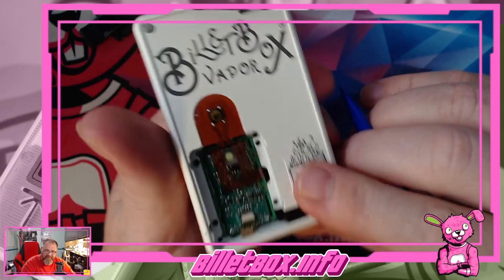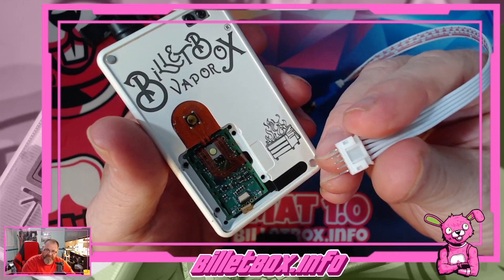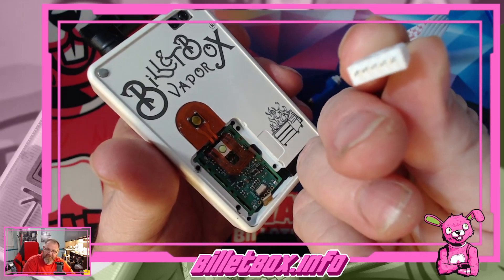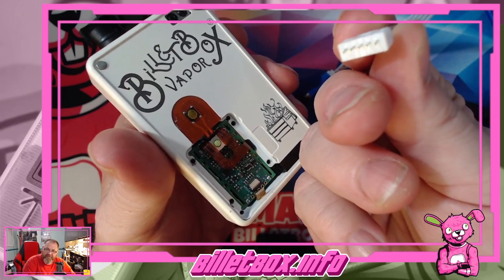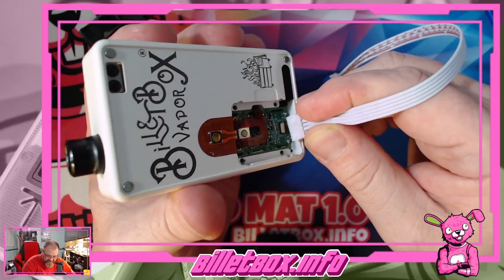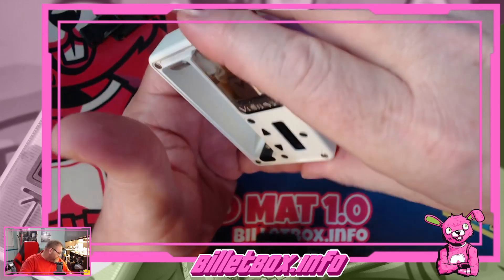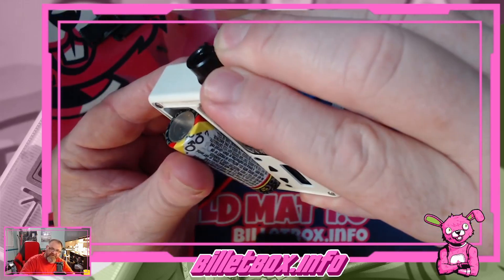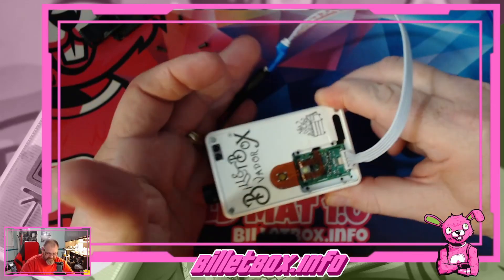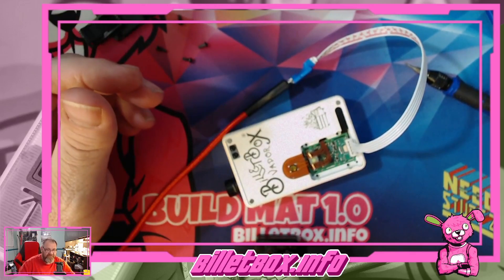At this point it's loose — just pull it out of the way a little bit. Now you can see your five holes. Flip the latch down for now. With the battery still out, nothing's going to happen when we plug this in. This particular cable doesn't have a keyed orientation, so you've got to guess. I've gotten to the point where on this cable, the pins are closer to the top on one side — that side goes right here. Take those five pins and drop them in the five holes, and there we have it. Pop the battery in and you should hear the computer connect.